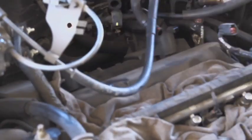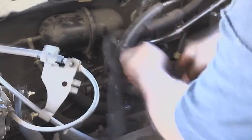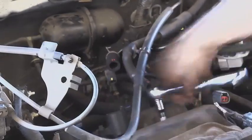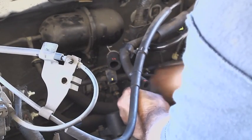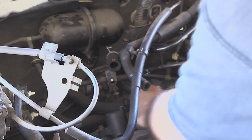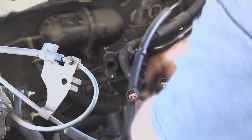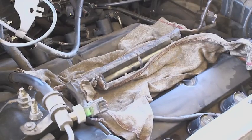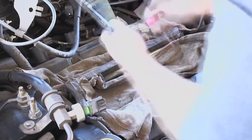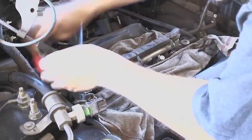Here's my spark plug kit — my spark plug gapper. I use the wire one for more accuracy. Spark plug back in, coil on plug back in, and the bolt to hold it in there. There's all my disconnected vacuum lines. Dielectric grease on the coil-on-plug connector for the top of the spark plug, same thing on the electrode connectors. I cover the port so nothing falls in there, and I use tape on the socket wrench fitting so they don't accidentally come apart and fall inside the motor.